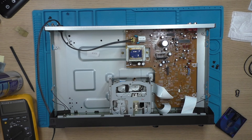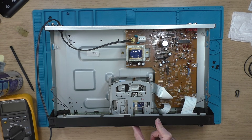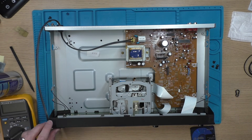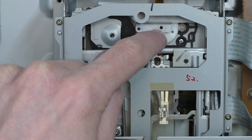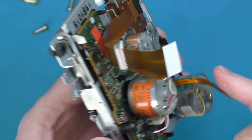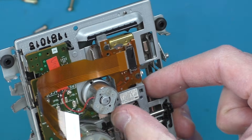I'm going to plug it in. We have exactly the same issue. Let's try putting a disc in. The power button is unresponsive. For some reason that motor is powering up when it shouldn't be. It's definitely this Mitsumi motor that's running when it's powered on — that's the one responsible for moving the laser back and forth.